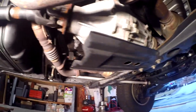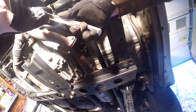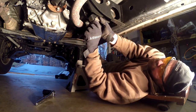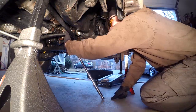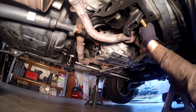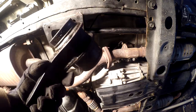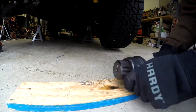You can see the new one — it's silver over there — and this is the old one. So we're going to get this one out of the passenger side. First thing is to get this 30mm bolt out. This is the one that gives people a lot of trouble if it's rusted up — this one looked a little more corroded. Just like the driver's side, take out the adjustment bolt and then loosen the nuts on the torque arm. Once the torsion bar is out of the vehicle, you need to remove the bracket, and that can be a real pain.